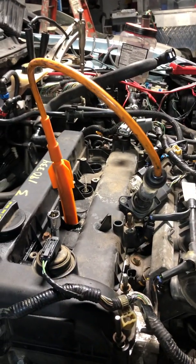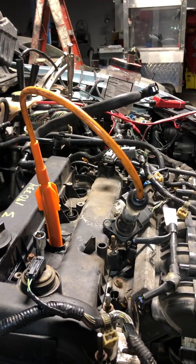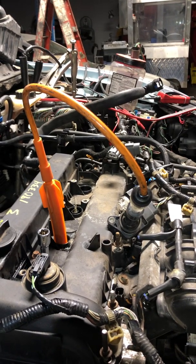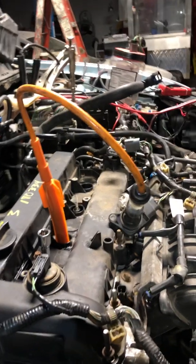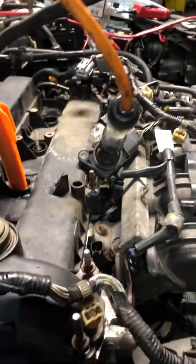I'm making this quick video about my 2008 Mazda 3. I did an engine swap and had to remove the harmonic balancer. After that I had no spark and no injector pulses — only one time each, and then nothing. I looked online trying to find a video but couldn't find anything, so I figured out what to do.